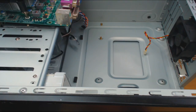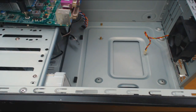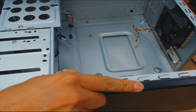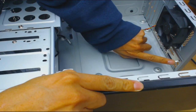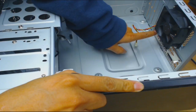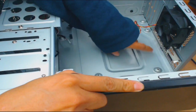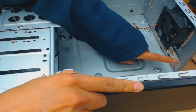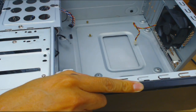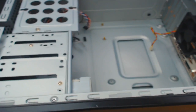That's all you do to pull out the motherboard — set it aside. Then there's the IO port in the back. See these little pin connectors here? You don't want to just start yanking the motherboard up and rip it out because you could bend these IO port pins. On older computers these are sometimes hard to find, and you'd be surprised what people will charge for them.